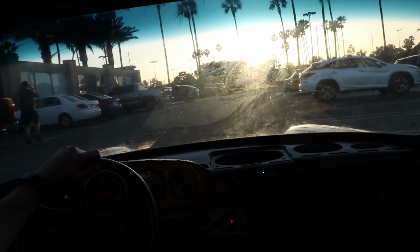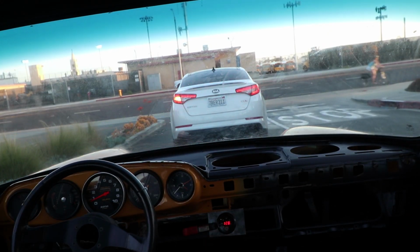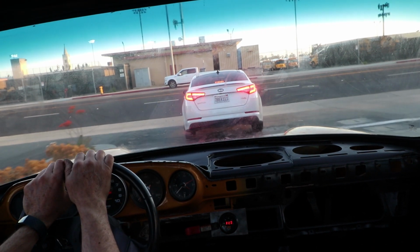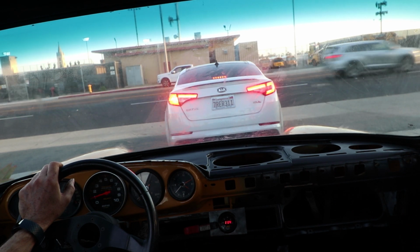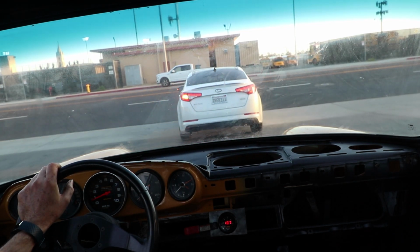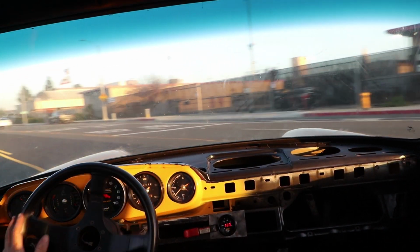Idle circuit, main circuit. It's idling right there at 12.5. Real steady on the idle. But the minute you come off idle, it will dip down. Even if the brake's on, I can just come off idle a little bit and the ratio goes down. That's more rich. See it going down to 10 or 11? So that tells me the idle jet is small enough. And this is the 50. It's getting plenty of fuel.